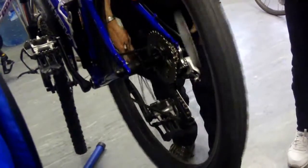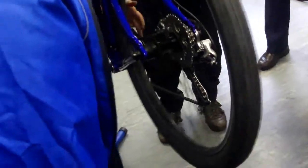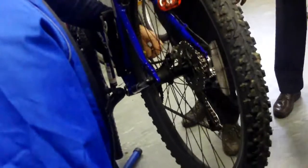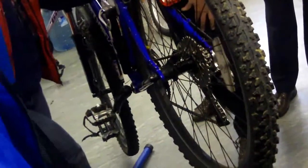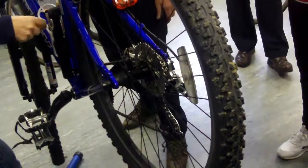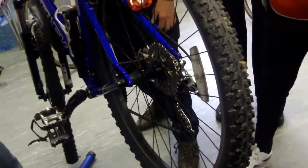That's what it does. So if this is the flop-taker-upper — we invented that word today. If we look at what's happening to this chain at the top, is that floppy or is it under tension? It is under tension. So when you go to change from your smallest cog on the front to your biggest cog, that's why it's not as easy — it doesn't have a flop-taker-upper. So if you are trying to get up a hill and you think, 'Oh my goodness, I need to be in number one at the front,' it's going to take some effort to do that.